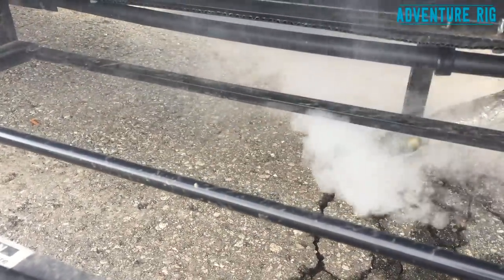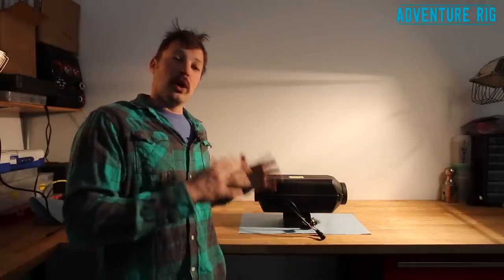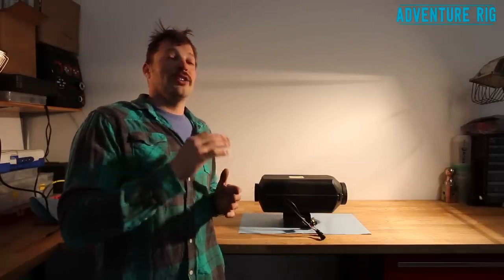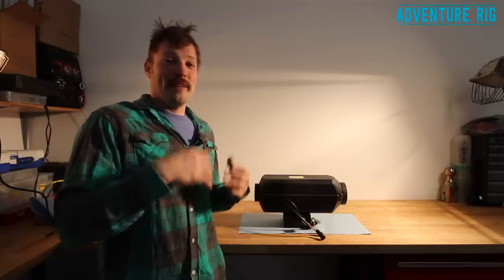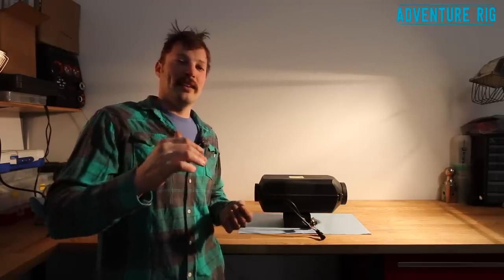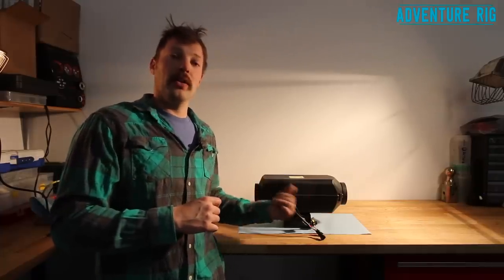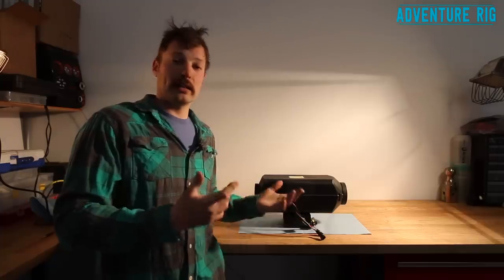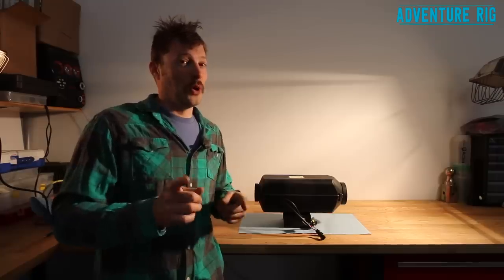I emailed them. They got right back to me and said it's built up with soot. If you run that low setting, or if you're running it 24/7, maybe every 12 hours kick it up to the highest setting — the most heat output — and that's going to burn off all the soot that's been collecting in there and clean the heater. For some reason they don't tell you that in the directions. I don't know why, but I've now told you.